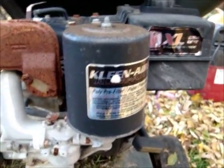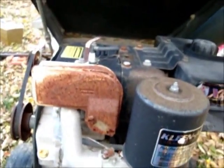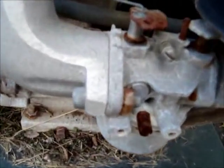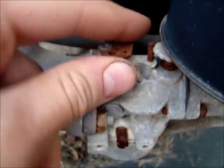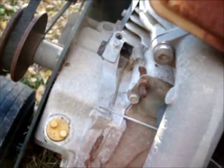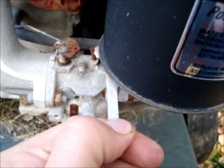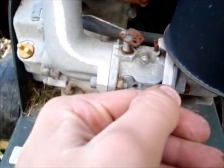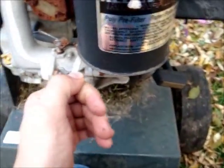Clean air filter. So first glance it doesn't look too bad, except for the carburetor. The throttle is stuck — that's not the governor arm, it's the throttle arm. And the choke is stuck too, that's really stuck.